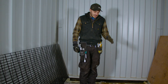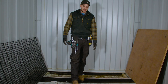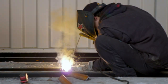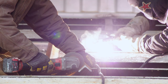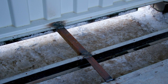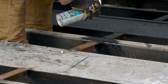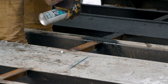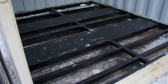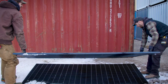With this bar grating here, because we have a partition wall running down the center, we're going to weld in some stiffeners, which is going to allow us to screw that partition wall down into something, because it's going to be kind of hollow under here. We have our center supports all welded in, and we've taken some rubberized spray and hit all the tops of the channels, because that wasn't undercoated when the existing floor was on, and now the elements will be landing on there, so just protect that steel a little bit better. The next step is to throw the bar grating in.